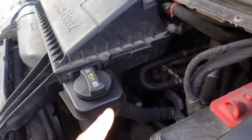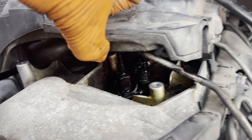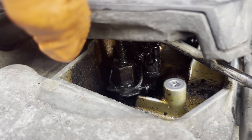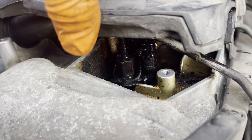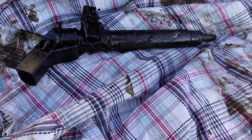Underneath here are the injectors - we'll see them in a minute - and one, just one of these injectors is chuffing. And this is called, with Mercedes, Black Death. Effectively the injectors are blowing by a little bit of the fuel and cylinder emissions out of the surround of the injector into the area above, and eventually this will kill the engine. Presumably that cylinder isn't going to be running with the right amount of air in it after this. So I've got to take that old injector out, clean it up, and fit a new seal and secure it down. Fortunately it's just the front injector, as we'll find out in a second.